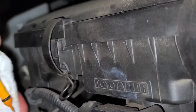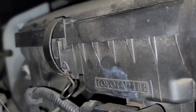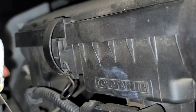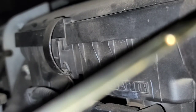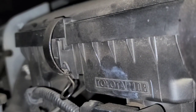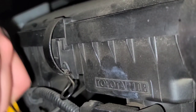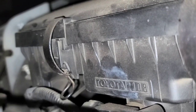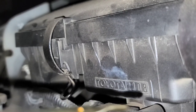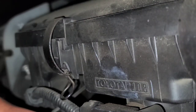Pull the dipstick up, wipe it off, push it back in, pull it back up, and check here. According to this the oil level is good — I think I put enough already. It could also be because my car is not on a flat surface since I have the front tilting forward. Usually you would do this on a flat level surface, not on a slope. But it looks like it's good. Make sure you screw back on that cap — and you're good to go.